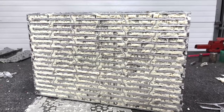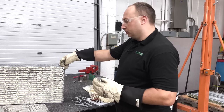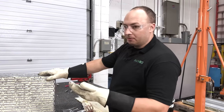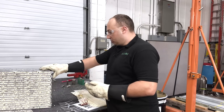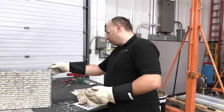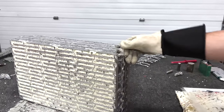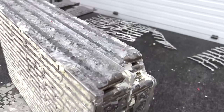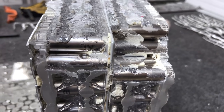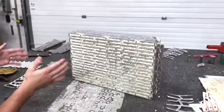For consistency of build, these are probably assembled upside down where the cells are placed into the top holder with maybe a thin layer of adhesive to keep them from moving around. Then the side plates are attached to give stability when moving the half-module around a production line. Once everything is secured with structural adhesives they can be attached to the cold plate pretty easily. You would have one half upside down, place the cooling plate onto it, let that cure, and then add the other layer.